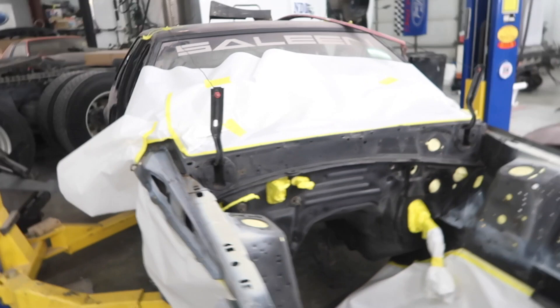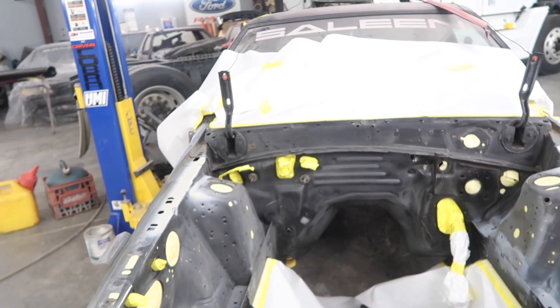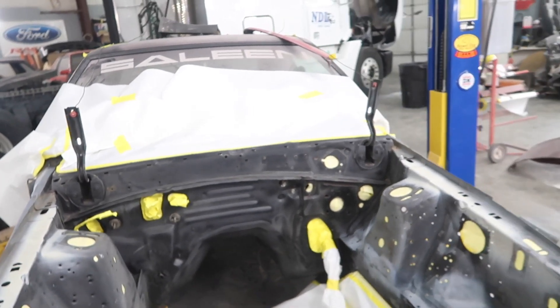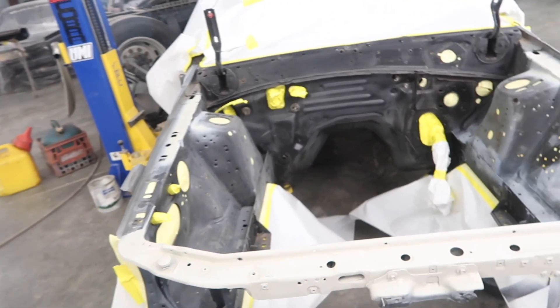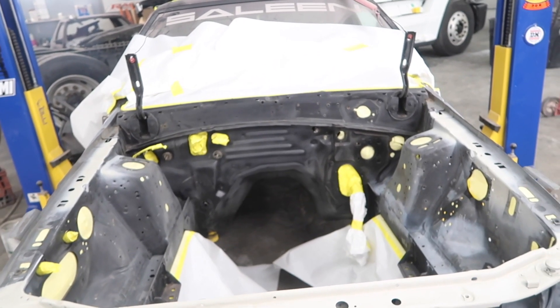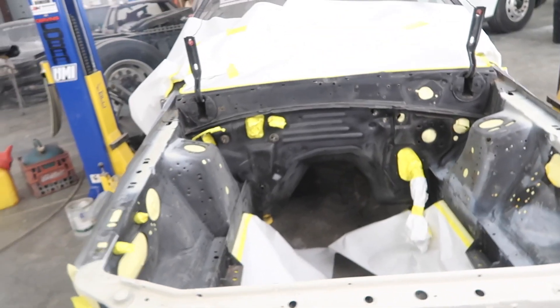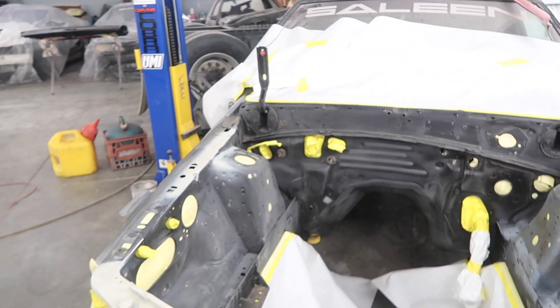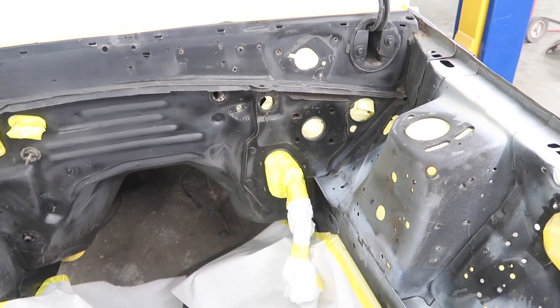There's actually no rust — I'm just a bit annoyed about the pinch welds. There's usually rust down there and in the shock towers, but the only thing this car had bad was the floor pans were jacked up, and the pinch welds were just folded over. So we taped everything up, took all the brake lines off, throttle cable, clutch cable, hood prop. These fox bodies are hard work — a lot harder than the SN95 and New Edge, and that's probably why Ford improved them to make them easier to work on.